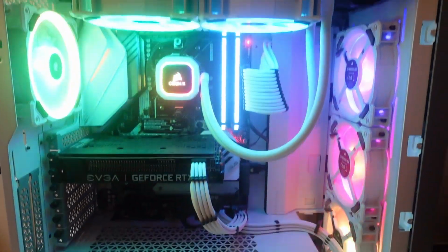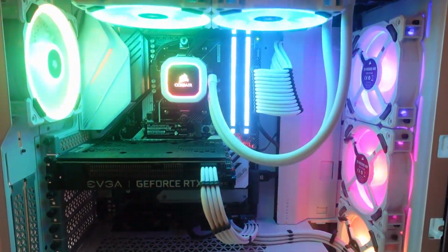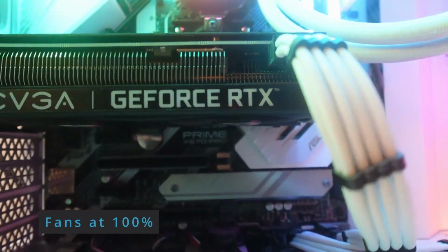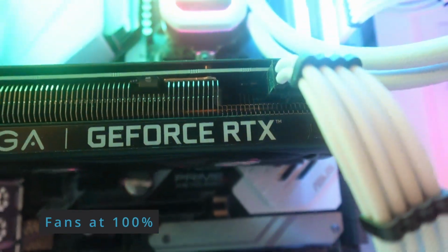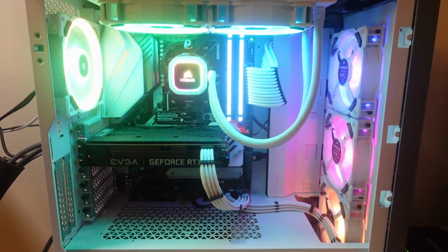Resetting the BIOS, but I don't think that's going to work either. You can look for the pins to reset the BIOS. I find it a little bit easier if I can get to the battery, just take the battery out for about 15 or 20 seconds. Much easier for me to do that than it is go poking around with a screwdriver.